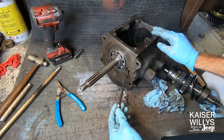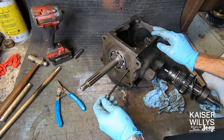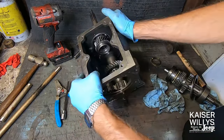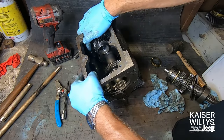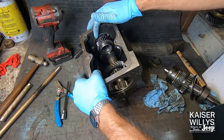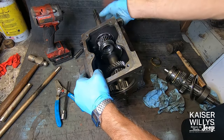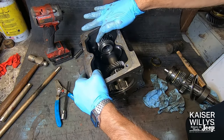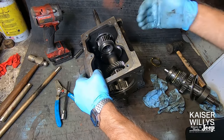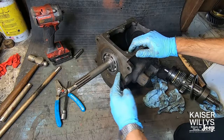At this point, the next step would be to remove these two bolts, which are a 7/32nd Allen cap head screw as well. That holds the oil slinger — a little trough of oil in there. This transmission doesn't have one; someone has just put the bolts back in to seal the oil off. Generally they're either ripped up, broken, rusted apart, or just completely missing. If you have one, it's just a sheet metal half circle that goes on the edge of the input shaft to channel the oil into the front bearing. This Jeep's been in service for years and the bearing is fine, so if you have it, put it back in, but if you don't, don't stress over it.